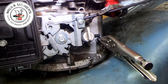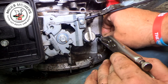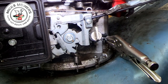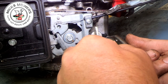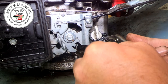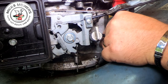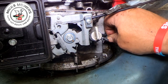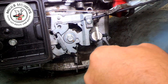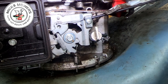Get your little tiny retaining clip — the one you just took out. I can just about see that groove, so I'm going to pull the governor arm out as best I can and push that little tiny clip back in. As you can see, I now can't push that governor arm in. I'm going to make sure by pushing the screws up against the seal that it is all the way home. It's just plopped into place — I just heard it go. That governor arm is now in situ, in place, with the little tiny O-ring behind it, and that little tiny pin ain't going nowhere. Triple check that pin is all the way in where it needs to be. You've now got a nice little oil seal just behind that, and that will stop the flow of any oil coming out of your governor.